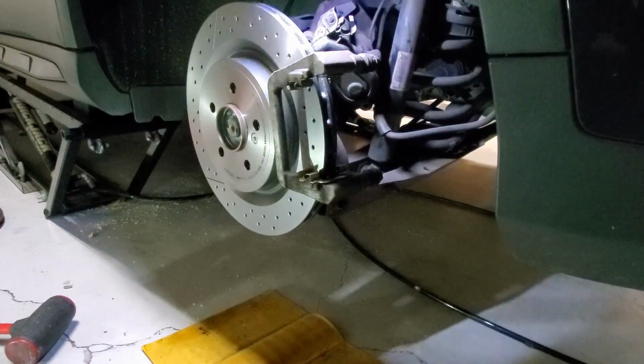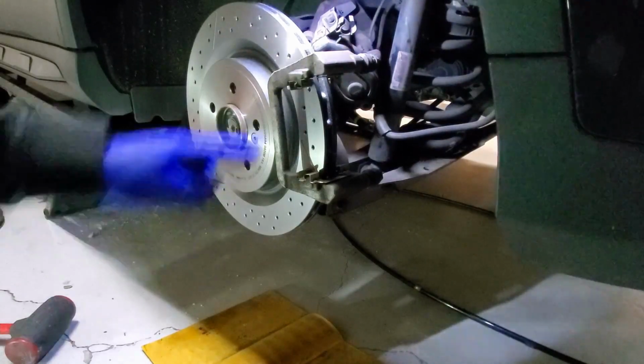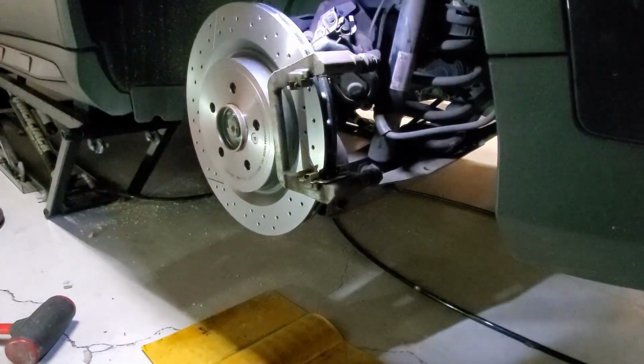I don't know the exact torque specs for the caliper mount, but it was really tight. A lot of caliper mounts are around 90 to 100 foot-pounds. I'm going to just torque this to 90 foot-pounds. If you know the real torque, go ahead and put that in the comments below. Or if I find out, I'll put it in the description section below.